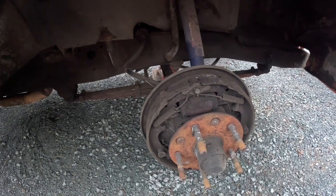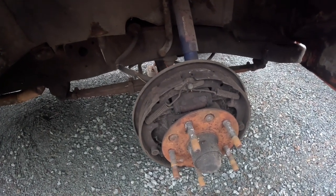Usually when I get a vehicle I'm going to replace two things as a matter of course. If it's a modern engine with a timing belt, that timing belt gets changed unless the previous owner can prove when it was changed last — when a timing belt goes it can mess up the engine and that's an expensive repair. The other thing is pretty much the brakes: check them out, and if there's anything weird with them, replace them, because these things are fairly important. Going is great; stopping can be better.